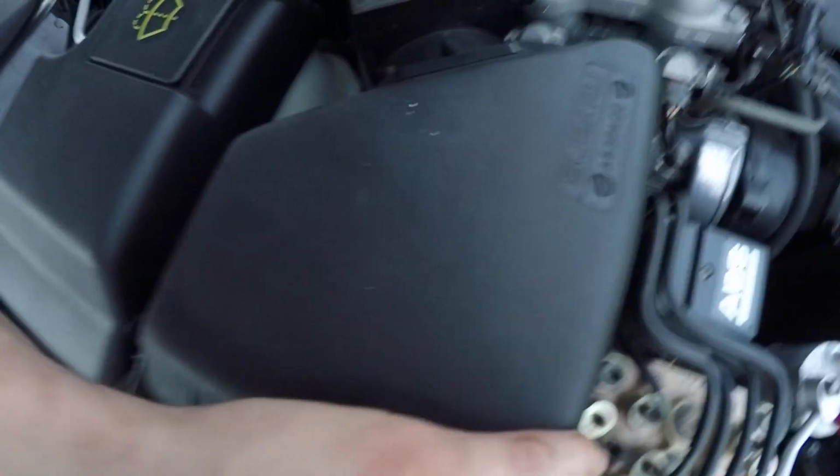And then you go ahead, make sure it's level, make sure it's not sticking out anywhere. Drop the box back in place, and you can usually tell by watching these clips because it should be somewhat close to where these things drop in. So you just move the airbox around a little bit, make sure it's seated, and as you can tell, super close. And then just pull the tabs back over.